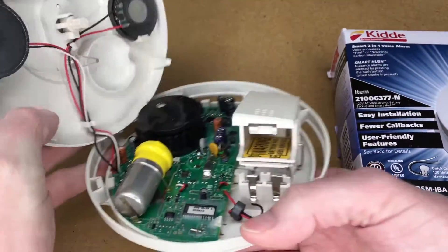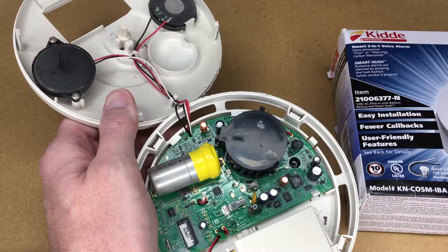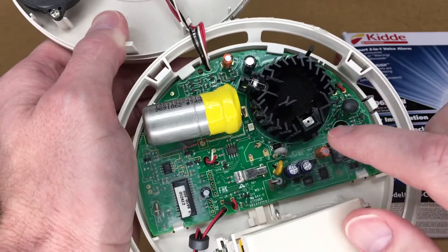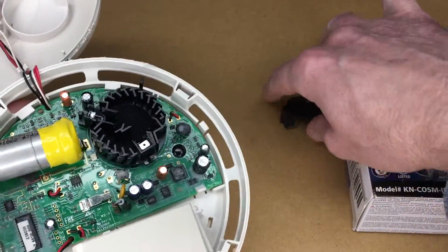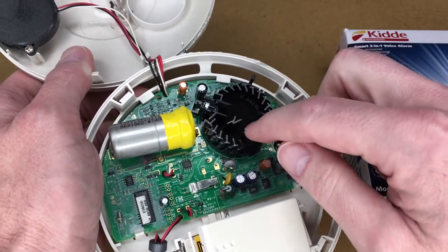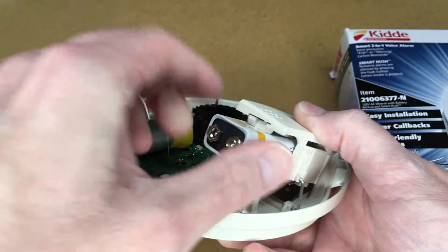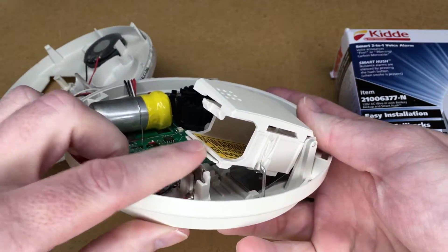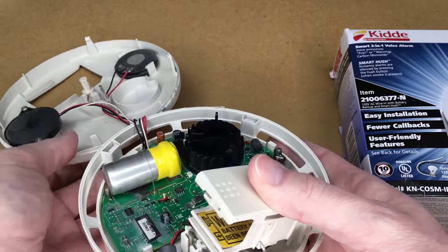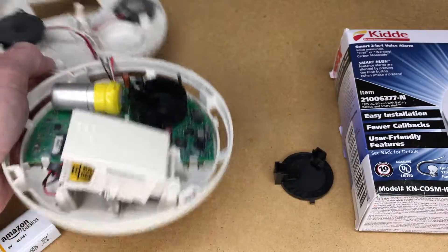Let's take a look at the old one. Opening it up, this does not have the nuclear or radioactive material — americium — in it. This is the photoelectric type. You can see there's an infrared light here and a detector here. Smoke comes in through these little vents, and the plastic normally blocks the light, but if you have smoke in there it'll diffract the light so the sensor can detect it. There's also a 9-volt battery mount — you can't close this without a battery in it because of this little lip. You shouldn't have one of these without a battery. And it has a speaker and a buzzer. I'm not entirely sure where the carbon monoxide sensor is on this one.